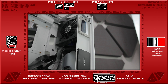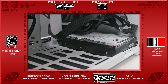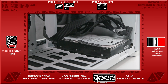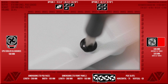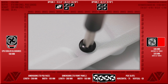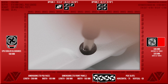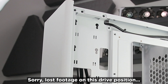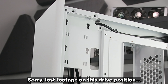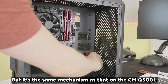Let's cover the drives. To the front panel you've got two spots for 2.5-inch drives. To the base, you've got a position for a 2.5-inch or 3.5-inch drive. All those drive positions use the standard screw-through-a-panel installation method, although I appreciate the groove cut-out of the side panel to allow screws to make it through past the return properly — a nice feature. The fourth and final drive position uses the grommet and screw method, the best drive mounting technique of them all.